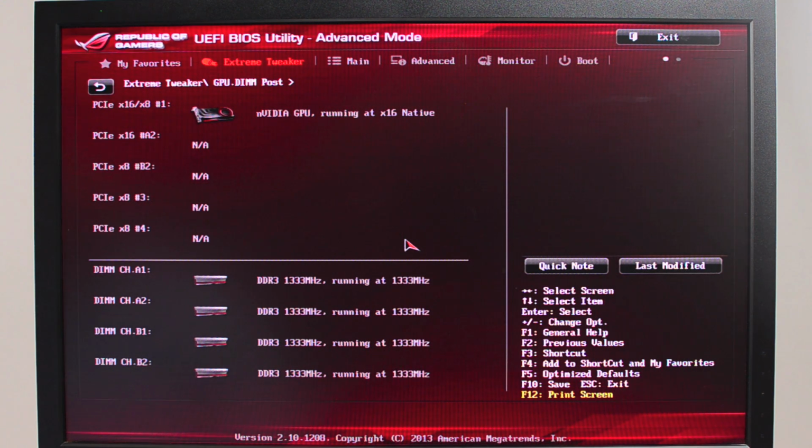Take for instance our board: if you always run on the primary top PCIe slot, you're always running natively directly through the CPU, but through other lanes you might end up going through the PLX. So depending on how you map it out, you might not be taking optimum advantage of the way that we've laid out the board. Our board even allows, in two-way configurations, mapping only through the CPU as opposed to the PLX. So if you're populating different slots, you can make sure it's set up the way you would like.